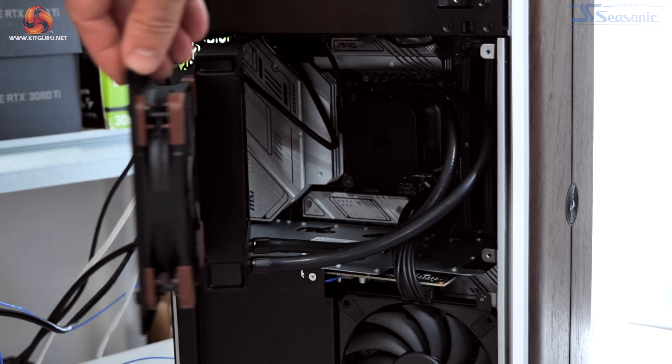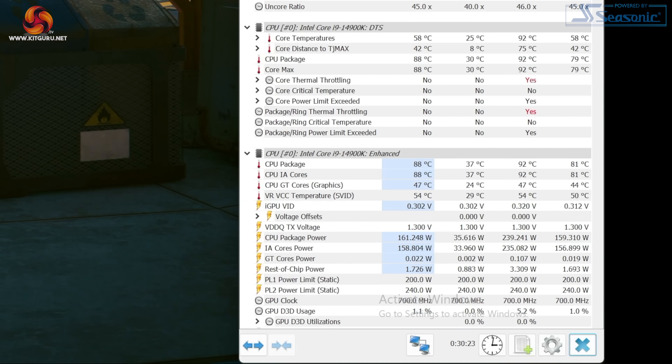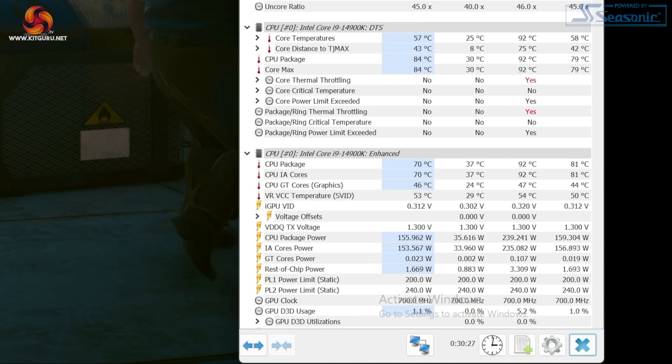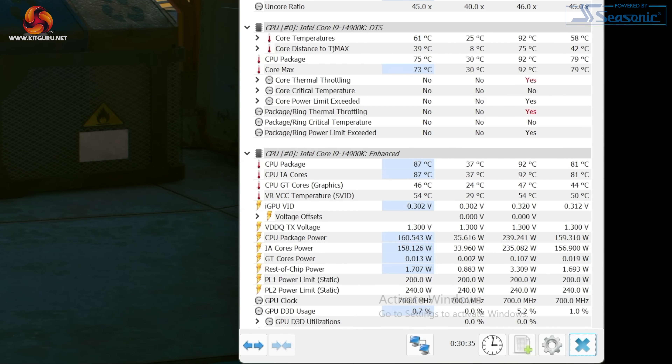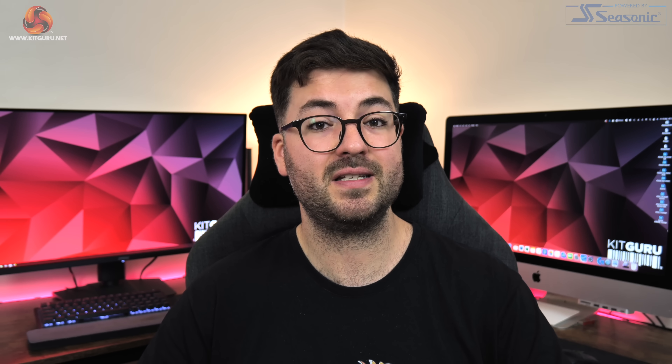You can see just how much bigger they look than the stock fans from the Corsair One, but I was still able to install them on that fan bracket and it closed up no problem at all. In terms of the thermal difference, the CPU was typically in the high 70s to low 80s region when testing with these thicker fans, and we can also see that it peaked at 92 degrees, which is down from the 95-degree peak we saw with the stock fans. These are 2000 RPM fans — about the same speed the stock fans were running at anyway — so we didn't see much if any reduction in noise, hovering around 47 decibels.